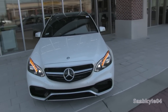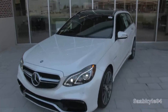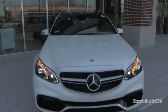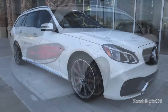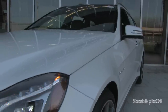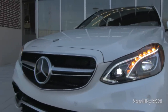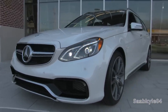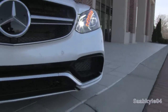As far as a quick E-Class recap, the W212 was a big departure for the E-Class when it was first introduced, in both styling and behavior. The car was all new from the sheet metal down to the steel unibody chassis that gave it an increase in torsional rigidity by 30%. It carried on the quad headlamps up front, but now they are more squared off than the previous oval lamps. From the front to the rear flanks, the body also saw more creases and sharp edges than ever before. This gave the E-Class a new identity. It was more assertive, modern, and sleek, rather than traditional and stately.